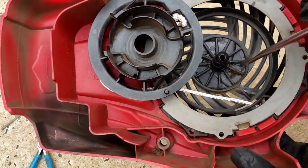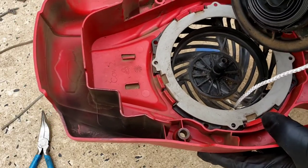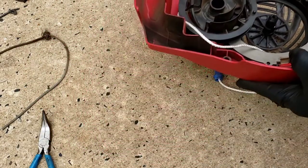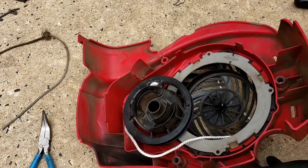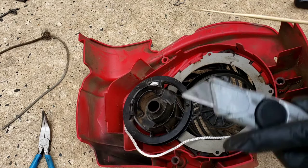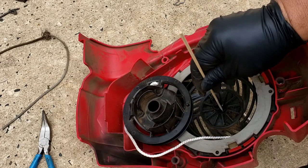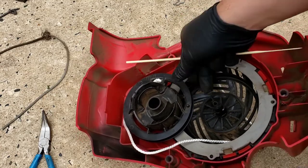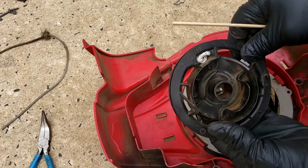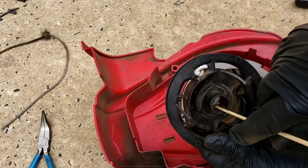There's a slot right there, and this is how I'm gonna get that piece in there. I want to get an idea of where the slot is — line it straight up so I know where it is. This is what I made: I took a barbecue skewer, which is normally round, and I trimmed it down with my little knife so it's almost flat. Because it's flat, I can go right in here and guide the spring behind there. I look for that spring — there it is — and I pop it up and stick this little flat rod in there to hold it.